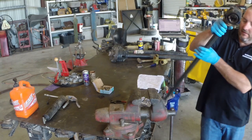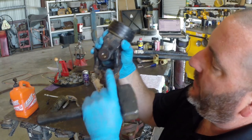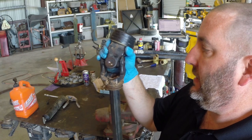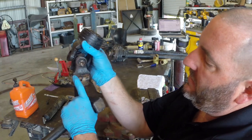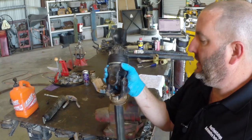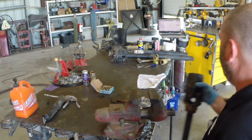There are actually pictures in TIS showing where you can hit and where you can't hit. If we hit right here on this edge with a hammer, we'll roll it over and we'll never get that cup out and may never get the new one in. Your area that you can hit is right here — it's a pretty beefy piece of metal, it's okay to hit it. We don't want to break or bend it, but we do want to get it out of there.